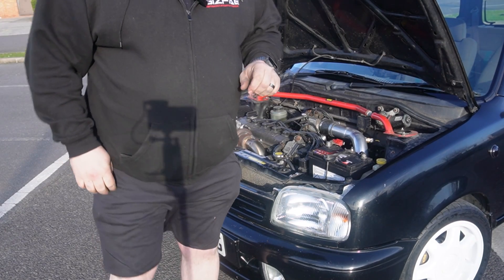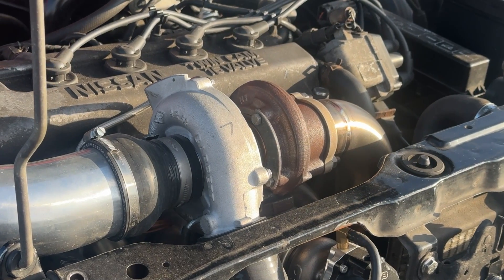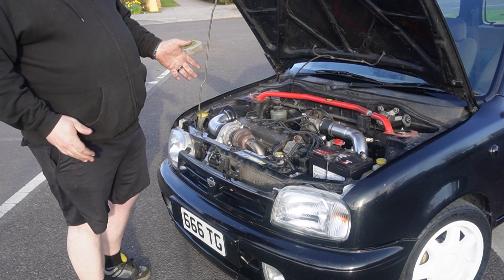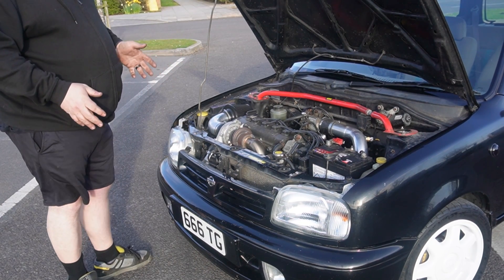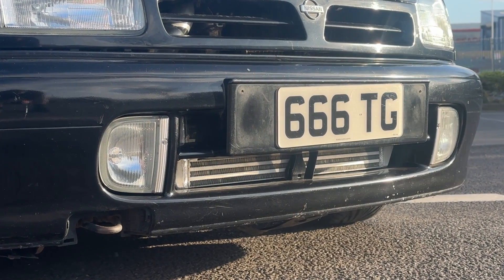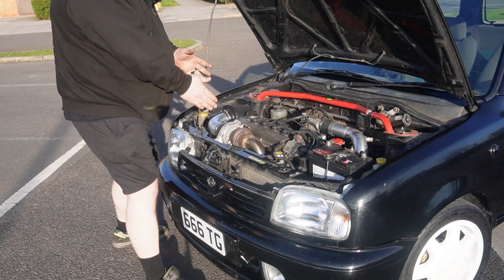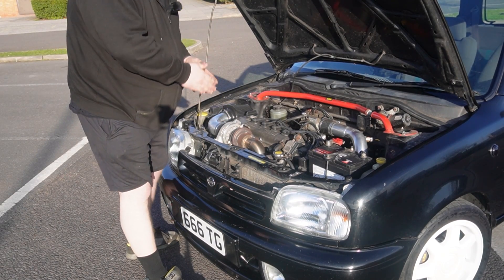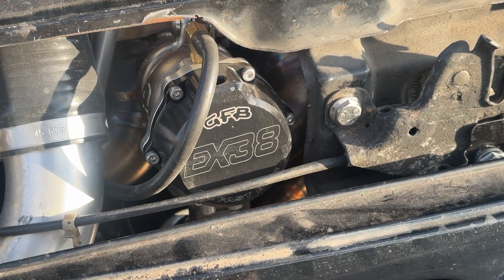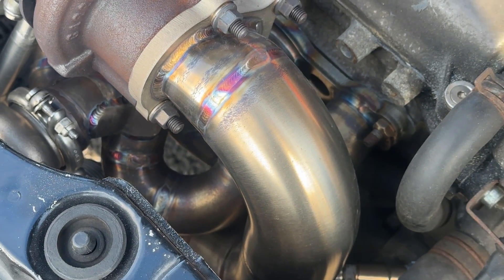It's not so giant — looks can be deceiving. This is a GT20, a Garrett GT20 ball bearing turbo. We chose this turbo for its size and its response on a little 1300 Micra. After driving it around for a couple of weeks road testing it for the customer, I can say that's a really good sized turbo for this engine — fantastic response with a bit of top end too. Attaching the GT20 to the engine is a full top mount tube and manifold that I made personally. For boost control, we have a GFB EX38 external wastegate and a full turbo-back 2.5 inch exhaust system.